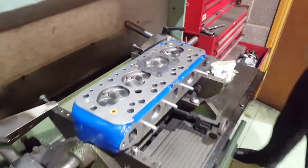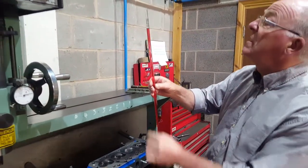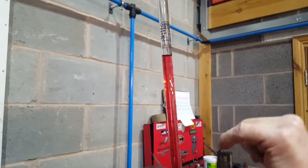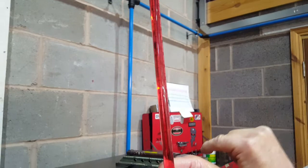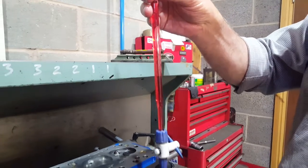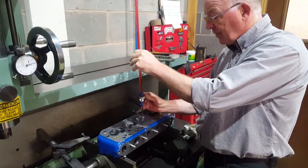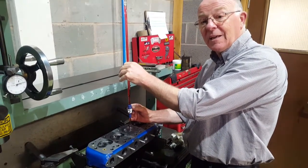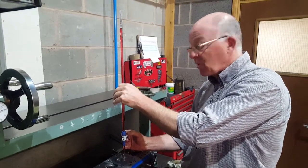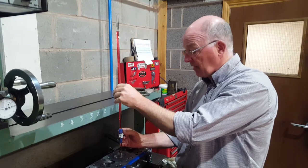What we'll do now is get a pre-filled burette. This is a glass burette — you'll see it's got increments. Each one is one cc, and inside it's divided into one-tenths of a cc. We'll start at zero and fill the chamber. As a rough guess, what would you normally expect this to be? The standard head from Rover is supposed to be 21.4 cc. This one's had the valve seats lightly cut, so we could be up to 22 cc on this one, but we'll tell in a moment.